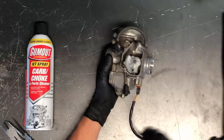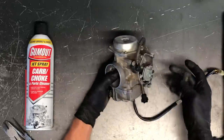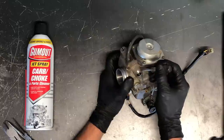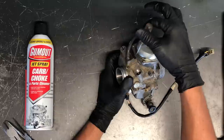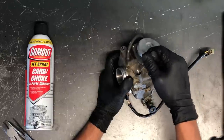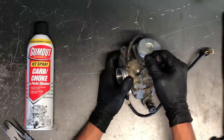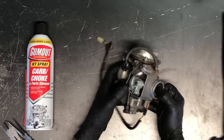We've undone this sensor here, and next is your choke cable. I don't have the choke plunger here to show you, but generally there's a 14 millimeter plastic cap that sits here. The choke cable runs through the cap, through a spring, and into a plunger. When you pull the choke lever, it pulls that plunger up, sucking more fuel and air through.